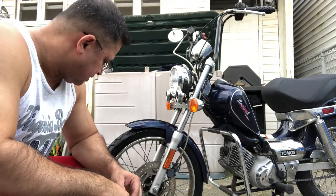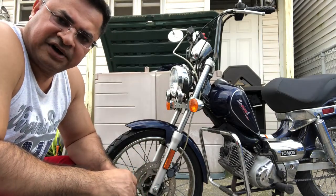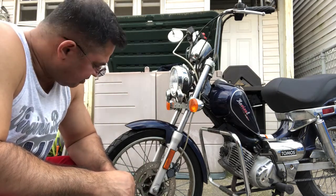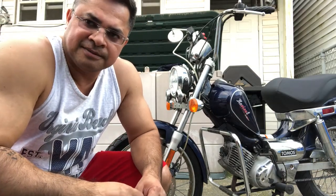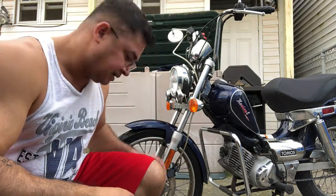Well, after running it for about 5-10 minutes straight, with the risk of overheating this little pump, the air is not taking, right? So it's not staying in there. So obviously we've got a bigger problem than just the tire not holding air. There might not be an actual hole in there, or something piercing the tire or the tube. It might actually be, and now I'm suspecting that it might be the valve stem itself, right? That might have to be replaced. Or maybe the whole rim, we don't know, all right?